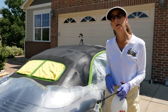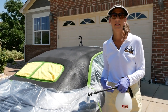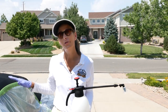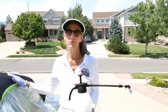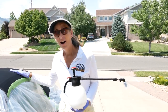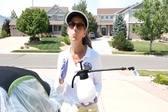I think we've got a great first coat. 303 says you really only need to apply one coat, but I've found that in our conditions here with bright sunlight, two coats works a little bit better and helps it last a little longer. We're going to let this sit out in the sun and set up for a few minutes first. Funny thing about this process is it's really one of the only detailing things you'll do in direct sunlight — 303 recommends at least 70 degrees and actually recommends you do this in direct sunlight. We've let it sit for about an hour and the first coat feels very dry, so we'll do a quick second coat and then we'll be done protecting the top.